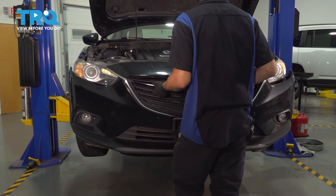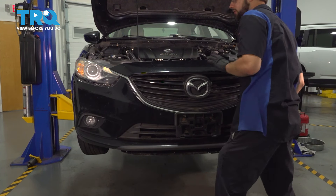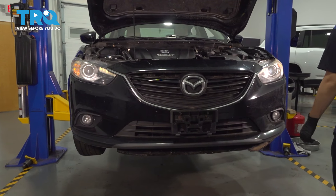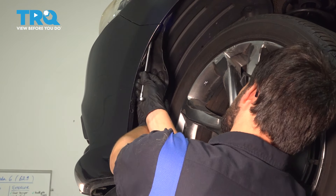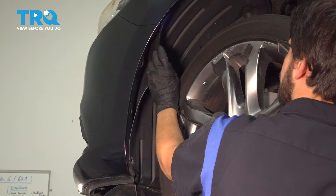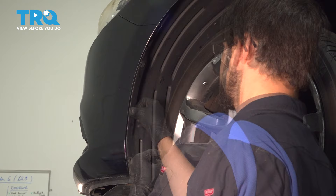Let's get the bumper cover back on. Take your bumper cover and slide it over everything. Make sure it lines up — you have those two alignment pins that need to fall into place, which you can see through the sides by the headlights. Once those are in, press them both in. That should hold your bumper cover in place on each side. Line it up with the fender and the headlight and tap it into place. On the side, let's put in the 8mm headed screw that secured the bumper cover onto the fender — snug it up, it's only going into plastic, so once it bottoms out just give it a little extra and that's it. Make sure you tuck the fender liner behind the bumper here, but on the bottom it needs to be over so that we can put all the push clips in. Reinstall all three — if any of yours were missing or broke, replace them. Do the same to the other side.